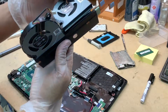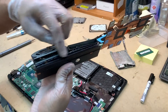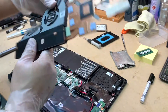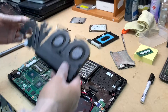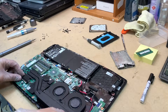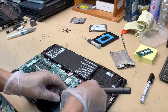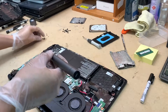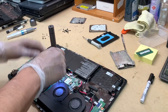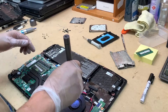The fan seems pretty clean. If you want to clean or replace it — cleaning is easy, and replacing it is just held by a strap, so just pull it out. I'm not going to do that because I don't need to replace the fan at the moment. Putting it back together is the same way we opened the laptop — it's pretty much a mirror of what we did to get here.